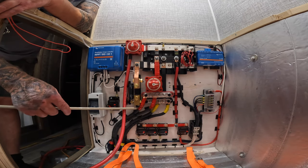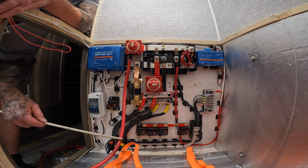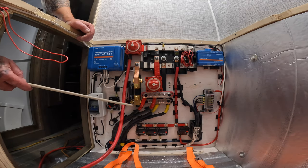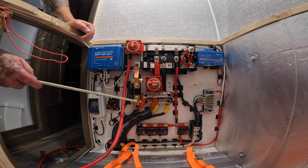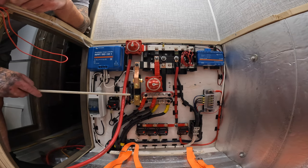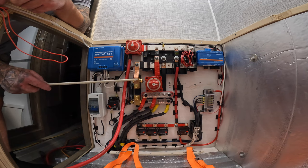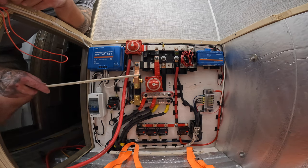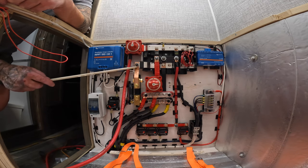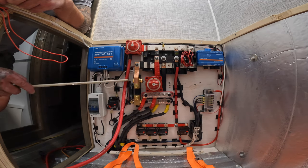These are 1-ought cables — parallel runs of 1-ought cable to the other side of the camper — and this is a 2-ought cable. The negative coming from my batteries goes up to here, and this is called a shunt. The shunt takes readings of your battery condition and everything. It says 'battery minus' right there — the wires coming off the batteries will go on here. This is also a bus bar. Wherever I can use a bus bar rather than a chunk of wire I'll do it — it's far superior.